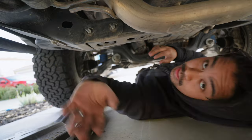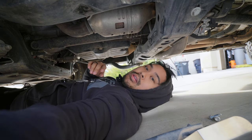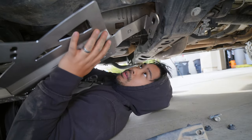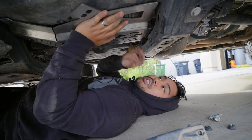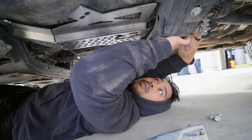From here it's going to be super easy. All you're going to do is take your cat cover and slide it in. It should just go right over — just go over the two bolts like so. Then you're just going to replace those bolts back in. It should look like so when you have it in the two adjustable little slots right there. You just want to hand-tighten these down for now.